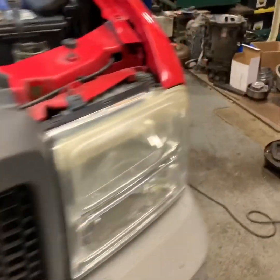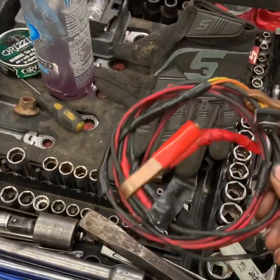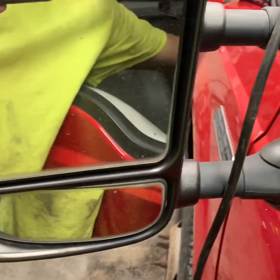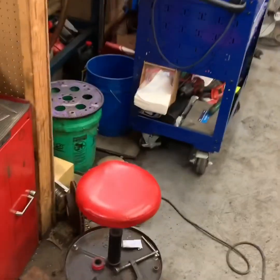Since it's hot and I don't really want to reach my hand down in there to put my little jumper plug for the IPR valve, I'm going to turn the key on and use the scan tool to run the IPR valve percentage all the way up so it builds as much pump pressure as possible. I'll use the scan tool to activate the IPR.